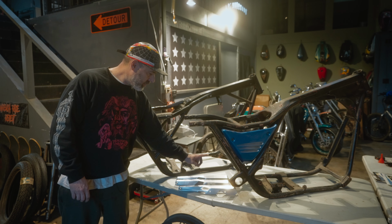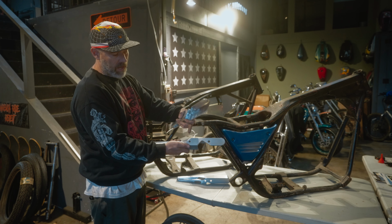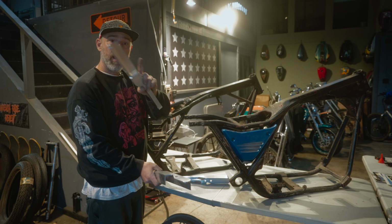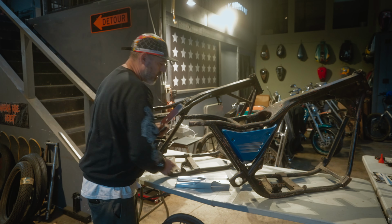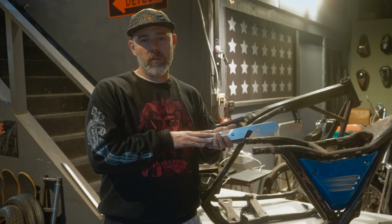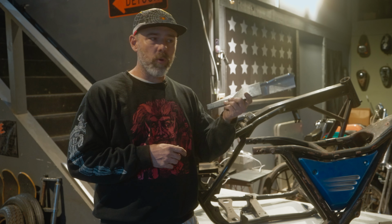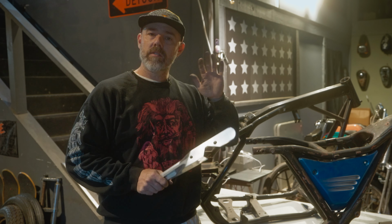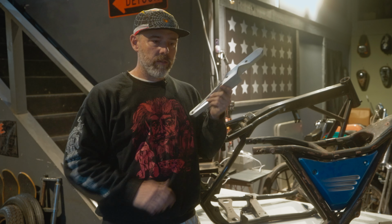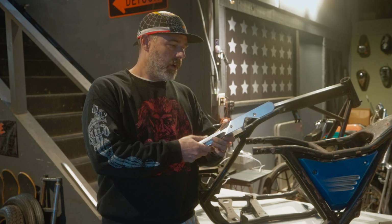You have type 1, type 2, and type 3. Again, RS fitment has the wider holes, and RT and RP have the narrow holes. And one more thing I forgot to mention. These are made in small batch right here in California. They're 6061 aluminum. I've done cast ones before, but these things are strong. Some of those die cast factory ones, you see them, they crack all the time, they twist. These are straight and they won't break from you doing a wheelie or something.